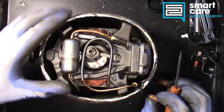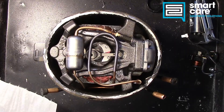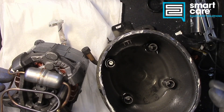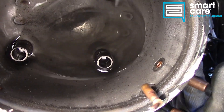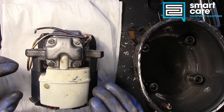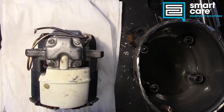I'd like to lift the motor out of there. You can see the motor has its own spring isolators inside — just little tiny springs. You can also see the oil that the compressor would run with. The electrical terminals pass through the shell. You can really see the suction lines — they're just pulling right into this open space. The compressor itself is going to have an inlet port drawing its inlet here, pulling that up through.